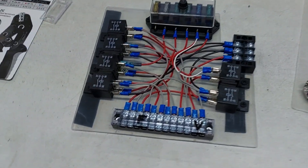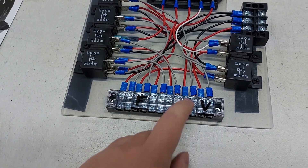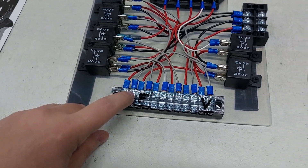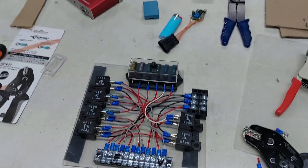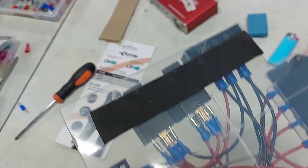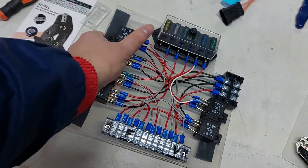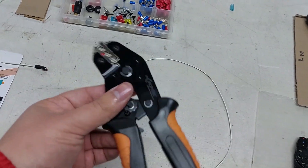I marked this one 'V' and this one 'F' — V is for VTEC, F is for fan. So I know this is a negative trigger with positive output, and this is a positive trigger with a negative output. The rest are all positive triggers with positive outputs. I put some foam strips at the back so it won't rattle where it contacts the car. I also cut off all the screw heads that were poking out on the other side. I'm going to put it in the car, hook it all up, and show you guys how it looks. I would definitely recommend this tool — I'll link it in the description.